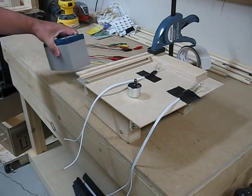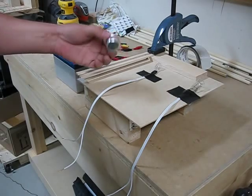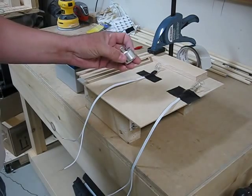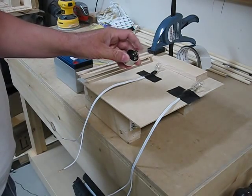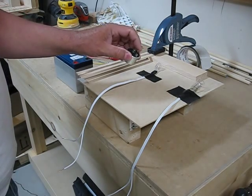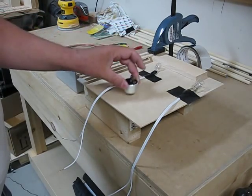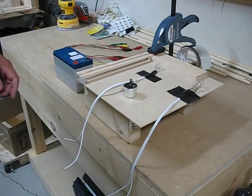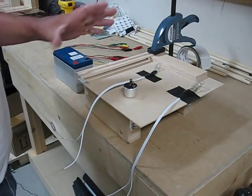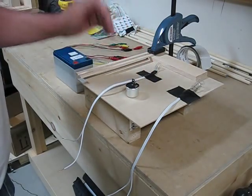On a motorcycle, we have our 12-volt power supply. I have a very cheap flasher unit that I bought at a local hardware store. It is very simple — it's got two pins on it. Power goes in, power comes out. Once you get some current flow, it opens and closes the switch inside. Now, I've also hooked up two little 12-volt light bulbs. On a motorcycle, you're going to have light bulbs at the front and at the back, so you're going to draw twice as much current. This flasher unit will work better when it has higher current.